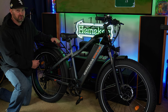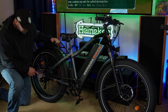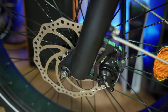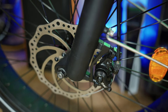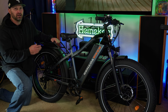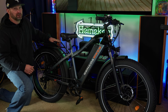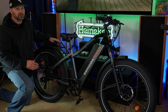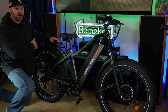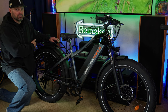This bike comes equipped with a Shimano 7-speed drivetrain — 7-speed cassette, 7-speed Tourney derailleur, 48-tooth front chainring, and 180mm mechanical disc brakes front and rear. One thing I'd like to nitpick: I do wish this bike had hydraulic disc brakes. It has a nice sturdy rear rack rated at 25 kilograms, which is about 55 pounds. There's a rear taillight on this bike, but as you saw earlier, this one was damaged during shipping.